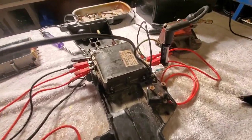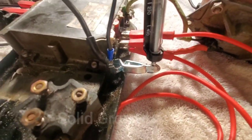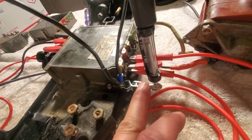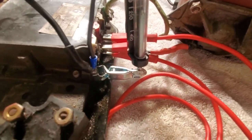Just for illustrative purposes, I wanted to show you guys how to wire it up. The first thing you want to do is make sure that you have a solid ground. I have the switch box grounded here, the coil grounded here, and then I have the spark coming right back in right here.